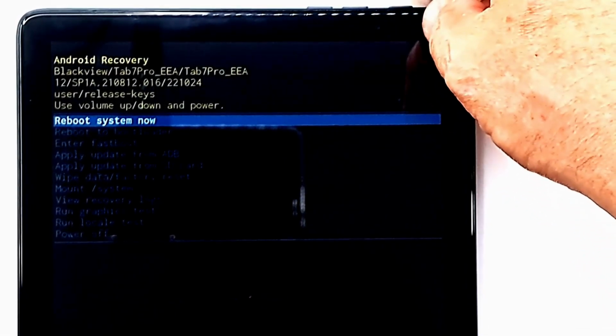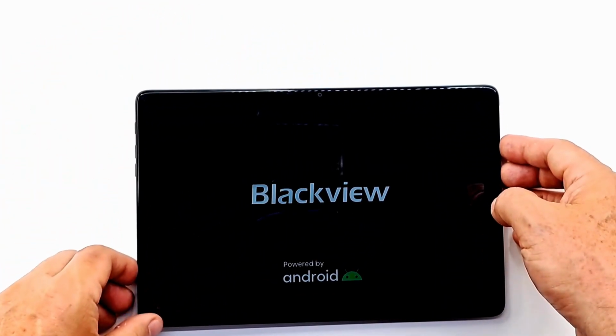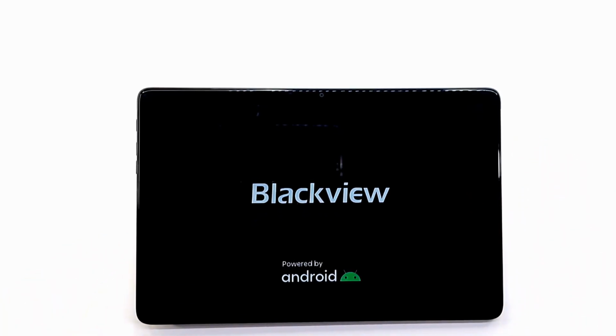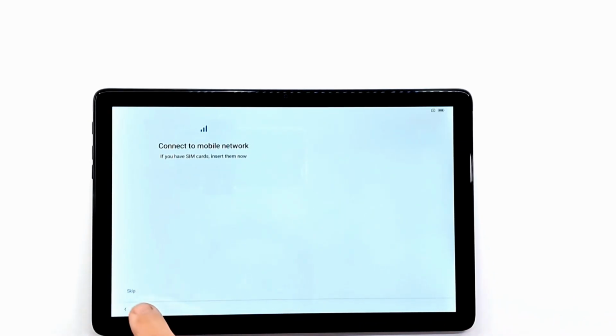Press Reboot System Now to restart. After 3 to 5 minutes the tablet restarts, and it will have to be configured again. If it had a Google account, you will have to enter it. The reset does not delete the Google account. I will do all the initial configurations so that you can see that the code has been deleted.